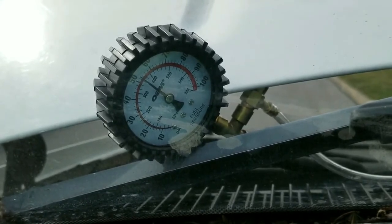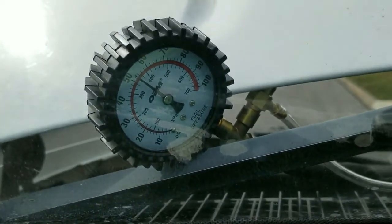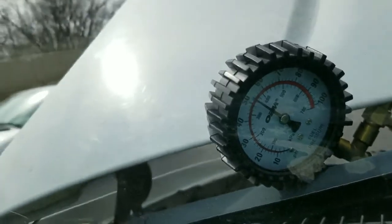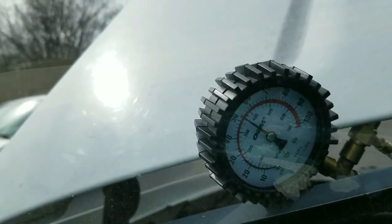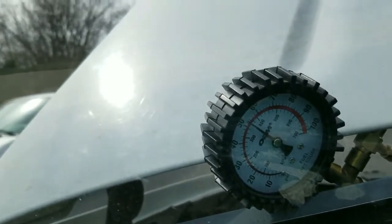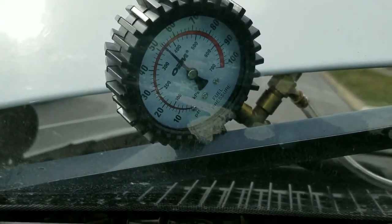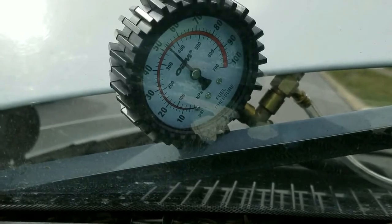I'm kind of getting that extra secondary hum. I don't know if you're able to pick it up on there, but that's the problem, and it certainly added more fuel pressure on that secondary hum. Now when it's running, that's at like 50, 52 or something like that. In the range, they say maximum free flow 50 to 57, minimum 40 to 48, so it's at like 52. That thing's right on. So that's what I'm battling, sometimes that little extra hum, and I didn't know what the heck was going on, but when I get that extra hum, it is certainly adding more fuel pressure.